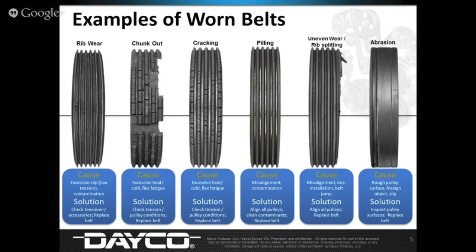This graphic shows the V and U example — it graphically shows that your V turned into a U, you lost material, and it won't react well. It'll cause belt slipping, which is usually when you start to hear noise, or alternator issues or air conditioning issues — mostly noise. This is like a lineup of all the various examples of belt wear. The first one is today's rib wear, where it looks fairly decent but the ribs are severely worn. The second is a horrible case of belt neglect with pieces missing — that car was still running, hanging on by a couple ribs. Professional technicians need to look at the back of the belt, the front, and the sides. If it's anywhere near 100,000 miles — we say over 85,000 miles with the original belt on — inspection is critical.